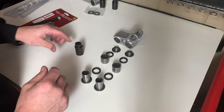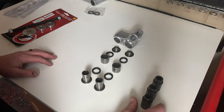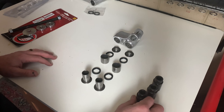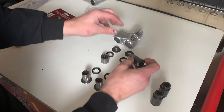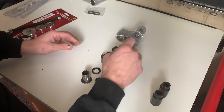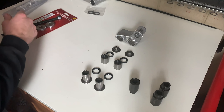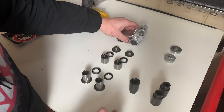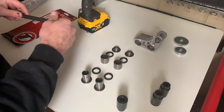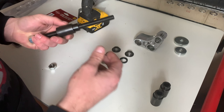What I like to do is get all of my bearings and seals laid out in order in which they go inside of these little holes right here. I'm going to knock this out quickly. This tool comes with three different size bearing drivers — you just got to find the one that fits up best to the bearing without a lot of slack. That one's just about perfect, so this is what we're going to use to push the bearing inside of its seat.